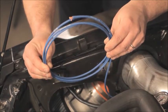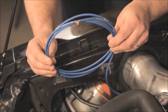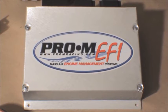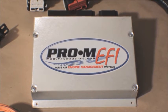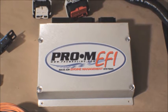Wiring is simple. Connect this blue wire to the hot side of the cooling fan or fans, and connect the ground side of the fans to a good secure chassis ground. That's all there is to it. The Pro-M EFI processor will turn the fans on and off based on engine coolant temperature and will turn them on when the air conditioning compressor runs. It also compensates for current draw on the charging system. It's awesome and you really should use it.